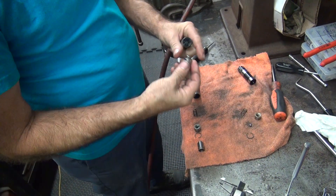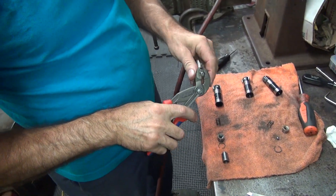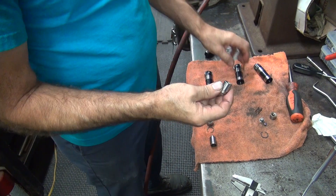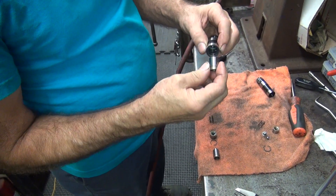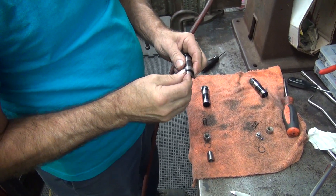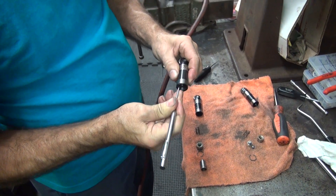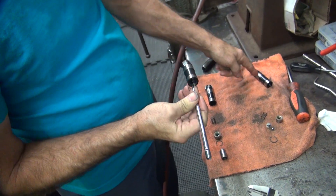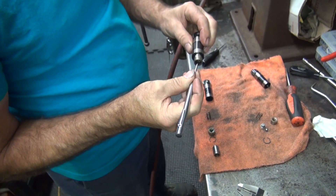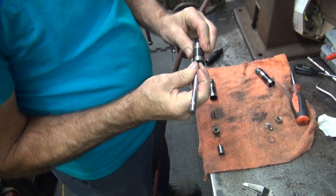I had all the stuff out of it, so I kept putting parts in there to see if it changed the depth — it didn't change it. So if we run this as a solid, basically this bottoms out in the bore down here. You have enough pushrod. All the way down — see this one doesn't stick at the bottom like that one does. That's all the way down, comes back up, turning 90 degrees, does the same thing.